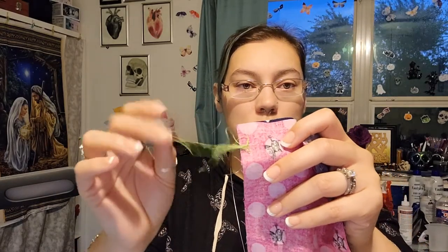Hello everyone, I wanted to jump on really quick and do a video. I have been sewing with my sewing machine for a couple of months. I cleaned it twice, replaced the needles, and maintained it, and all of a sudden I started to get a bunch of these bird nest loop thingies. And I know one of the biggest causes for that is tension.